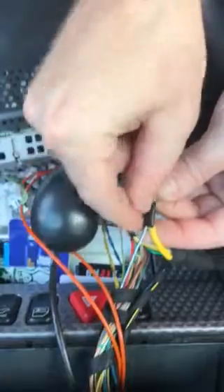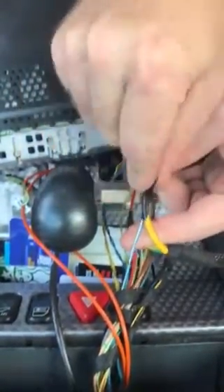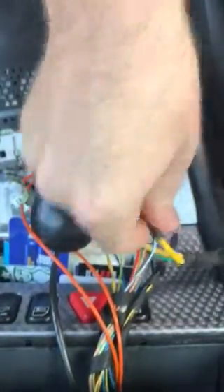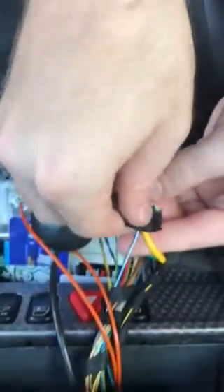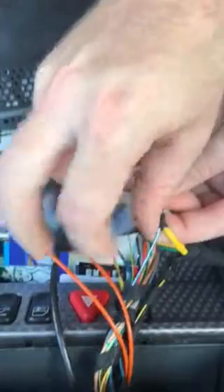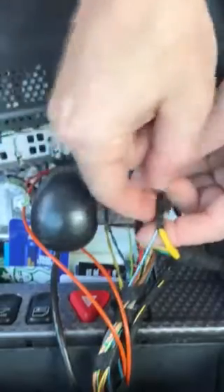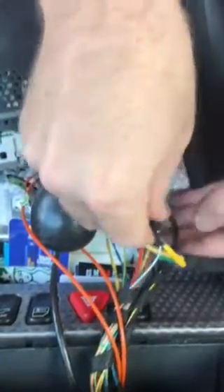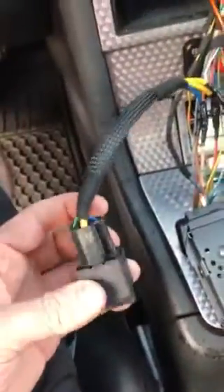Wire all taped up here. I always like to at least double tape my connections as well, that way there's no loose stragglies poking through that could end up shorting out anything. If I'm not doing any heat shrink, at least double tape to make sure you don't have any issues. Now I've got it fired up — this is how it can help somebody else. Just get your standard five-pin relay.